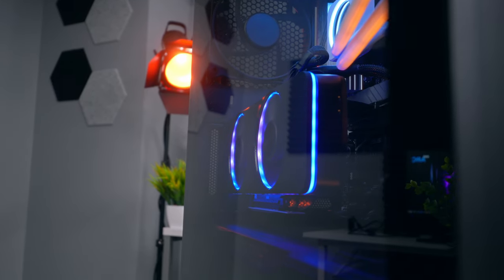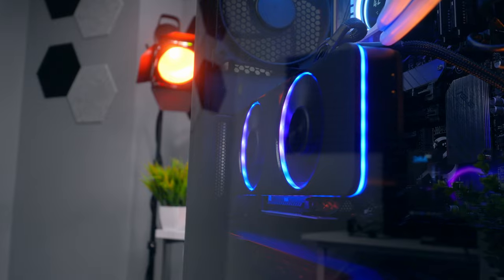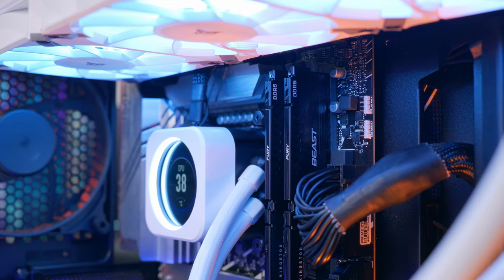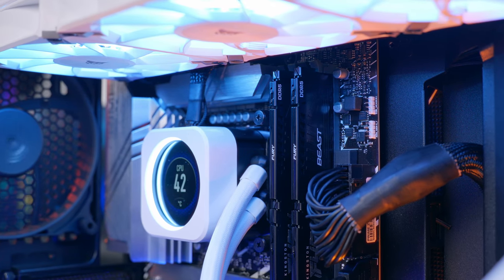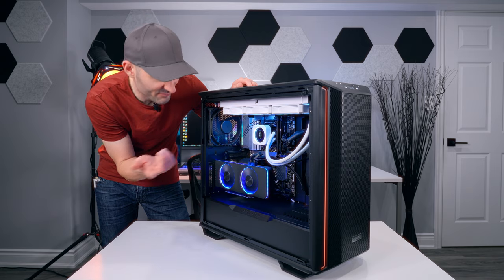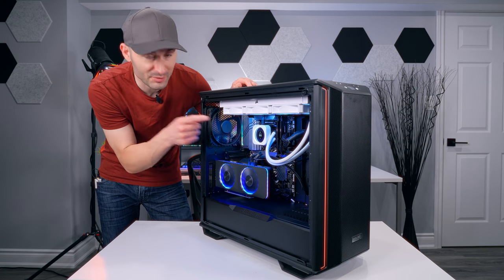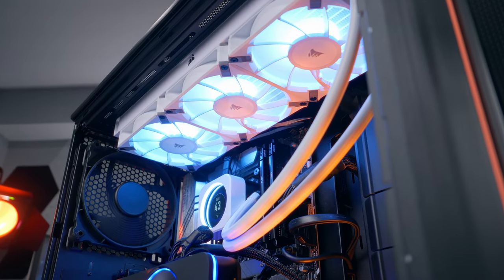With the glass panel on, you can see how close the GPU sits to the side when mounted vertically — and this Arc card is only dual-slot, so there's more space here than you'd get with something bigger. The other area to look at is the top-mounted radiator clearance: this board doesn't have big VRM heatsinks and the RAM is really low-profile HyperX Fury Beast with no RGB or crazy heatsinks. Even so, you can see how little space you really have with that radiator in position. If you want something thicker up there, you could run into clearance issues — this Corsair radiator is 27mm thick, which is really not all that thick.